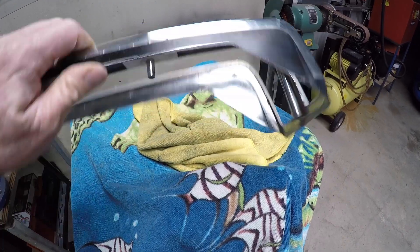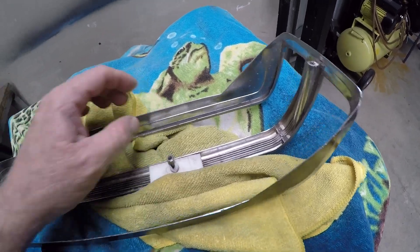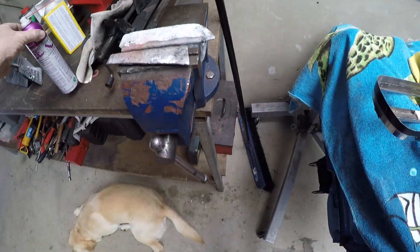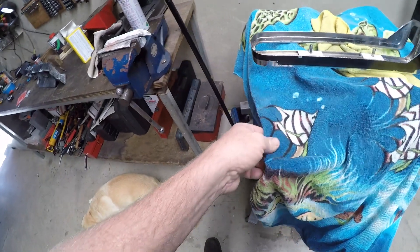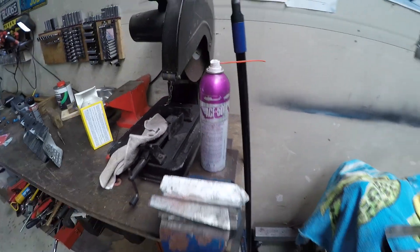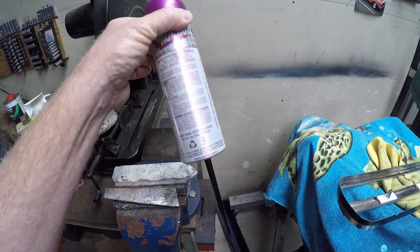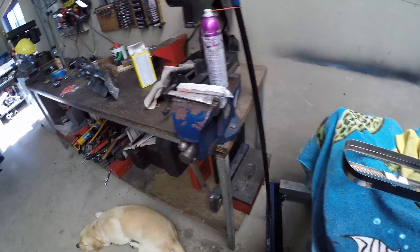If you've got these — looks like they're some sort of alloy, I thought they might be stainless or even plastic, but they're not. Alloy corrodes in a funny way, like that for example. There's another product out there called Corrosion X — you can get it on eBay. Again, that's from aviation — we use this stuff all the time. You can even spray circuit boards with it. Very good stuff. I'm going to use it for that application on the car.